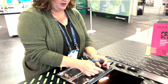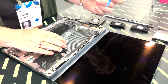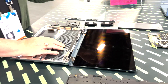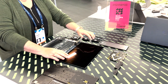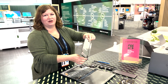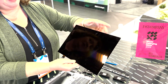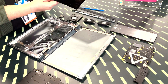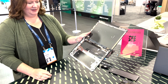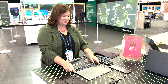So we want to make sure that we can get that out without breaking it. Just a simple removal of the display cable there. And with the tool, I'm going to do a quick press on this last keystone, remove that component. And with that, you can do a little press down on the display, and the entire display module comes out. So that includes your webcam there, running through your display cable back into the board. And what is left is the chassis. Even the chassis has a display cover QR code and a name on it, so that you can get spare parts.